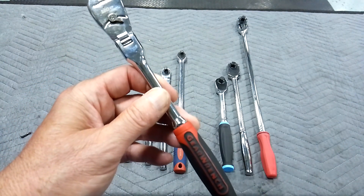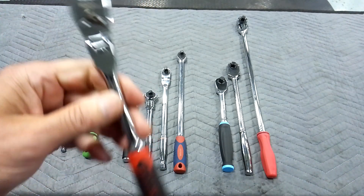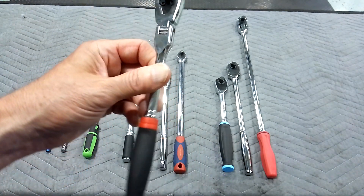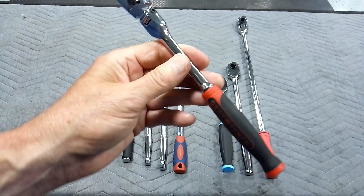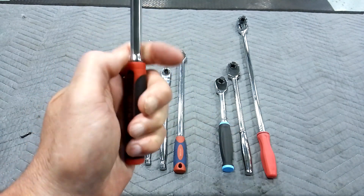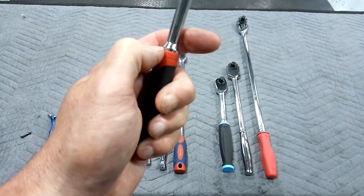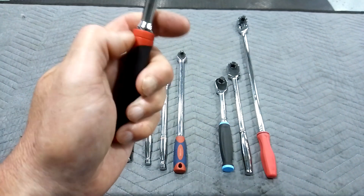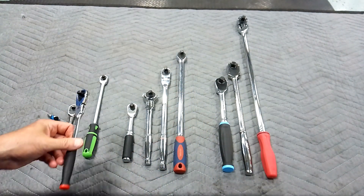You need a flex head. Flex head is so versatile, guys — for getting into those nooks and crannies and all those tough spots. You definitely need at least a few of these when you're starting out; if you don't, you'll be sorry. This one's made by GearWrench, the 120 XP, non-locking. I prefer the locking version, but whether you get comfort grips or regular grips is preference. Chrome grips are cold in winter and can sweat or pit with rust if the garage isn't heated, whereas comfort grips don't hold up as well with oil and grease and tend to wear out faster.